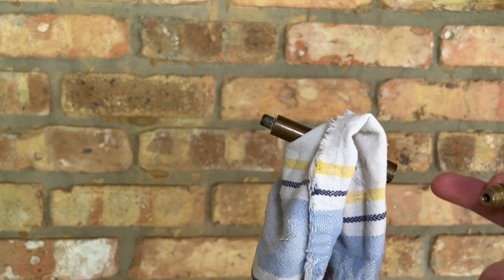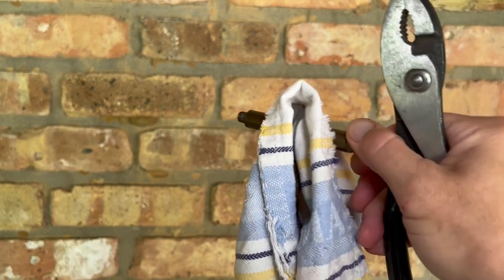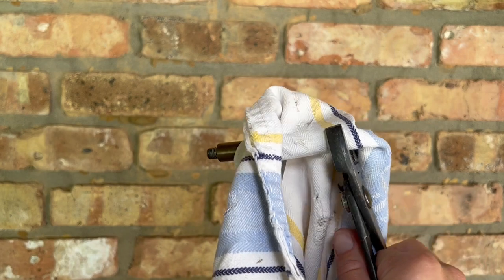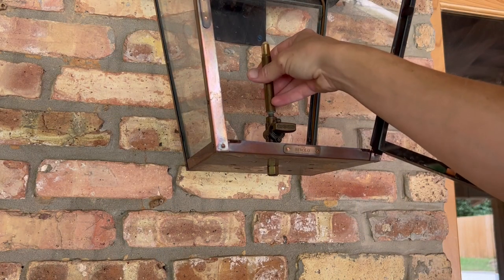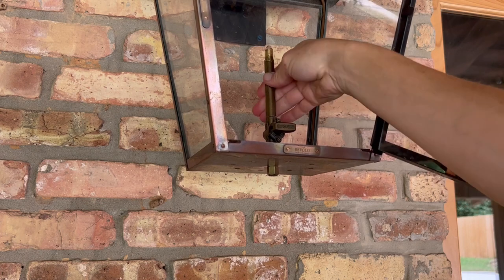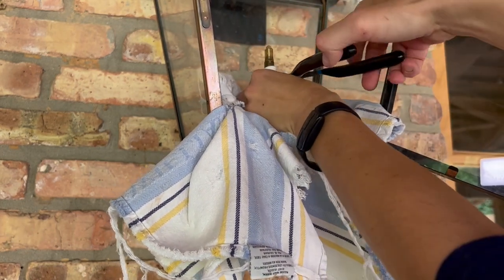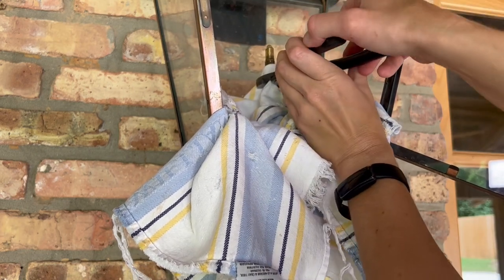We're going to go ahead and put this back together in the exact opposite way that we took it apart. I had to use this towel in addition to my microfiber cloth — I should have had two cloths; it was a lot dirtier than I thought. I'm holding this with my channel locks by the indentations here, and I'm going to go ahead and hand tighten this end on initially, then put this towel over the end and give it a little quarter turn to give it that final tighten. Same thing for the other piece — we want to go just a tiny bit beyond hand tight. Hand tighten it down first, then wrap it with the towel and use the pliers just enough where it is lined up the way that it was before — where the slit on the end is parallel to the front of the lantern.